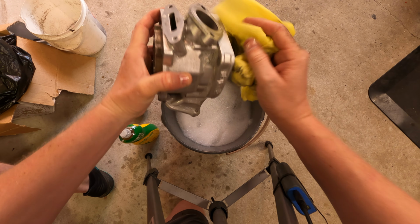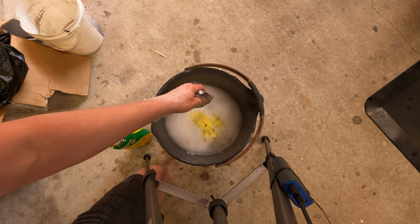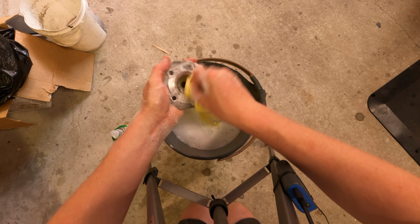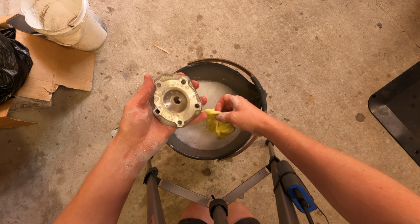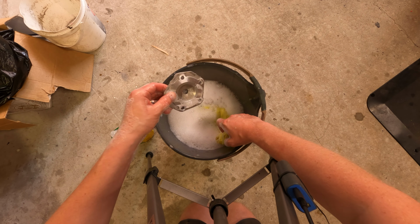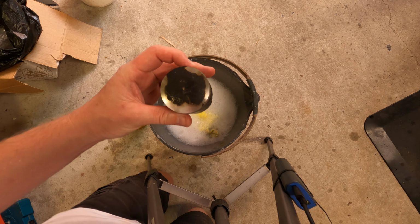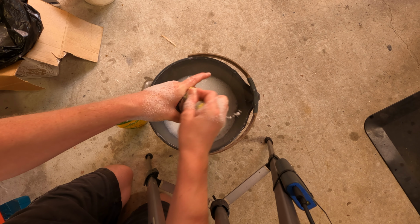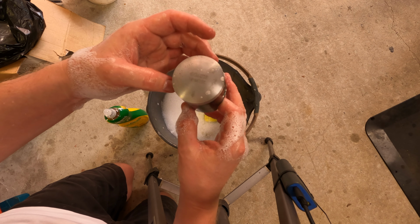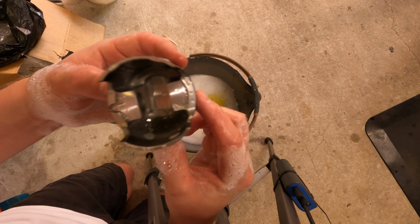When the bike was new to me, one of the first videos I uploaded to YouTube was a compression test video. I do this to get a feel for the condition of the engine. I found when the engine was cold, it was creating around 90 psi. I did some research on the internet and found this was a little on the low side, so for peace of mind, I decided to replace the top end components of the engine. The detailed top end rebuild is a three-part series that can be found on my channel. I invite you to watch that if you have the time.